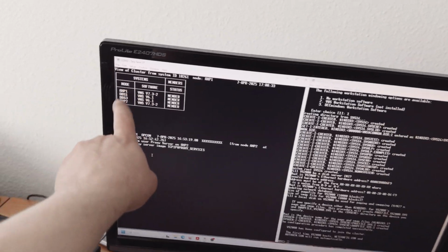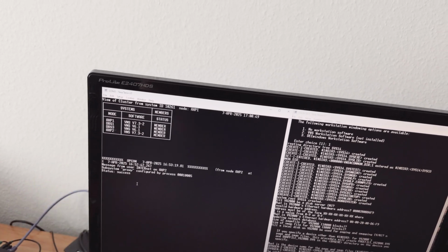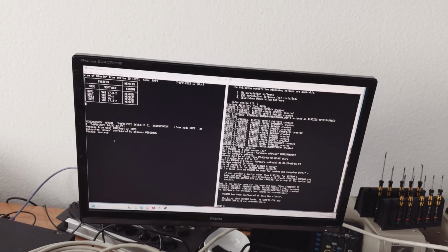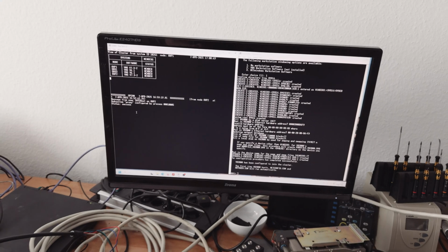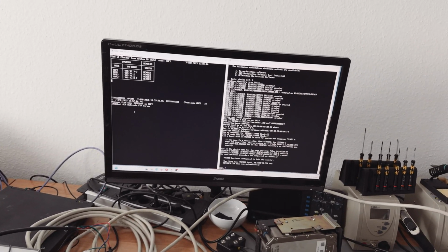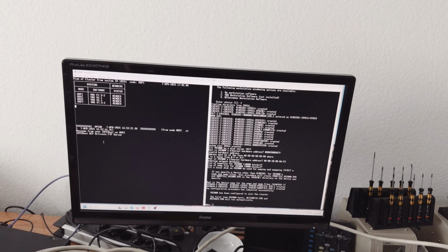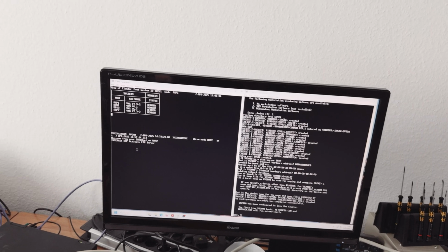And on the left you can see the cluster at the moment is running with all 4 nodes. The 5th node, the AlphaServer DS10, is not working at the moment due to my tests with Fibre Channel, so only 4 nodes are available at the moment. But you need only 3 to have enough votes in the cluster. Now I will try to start the booting from the VAX machines.